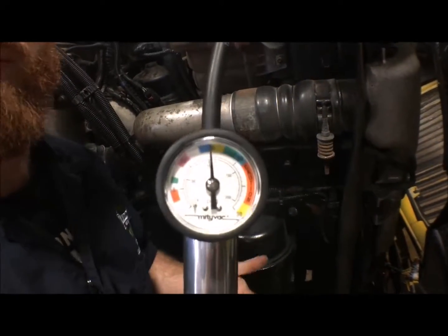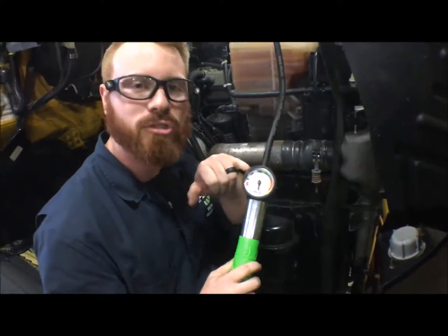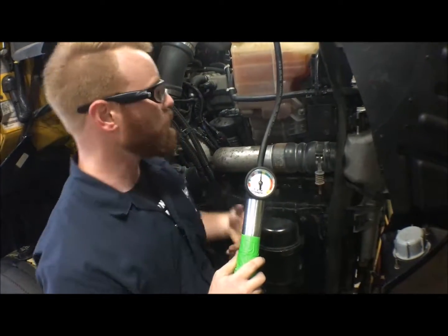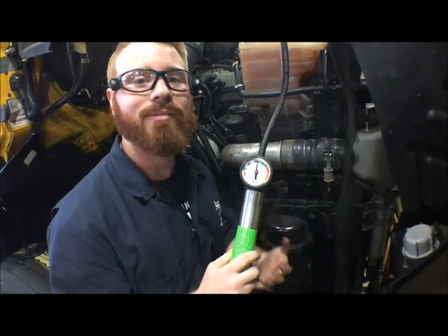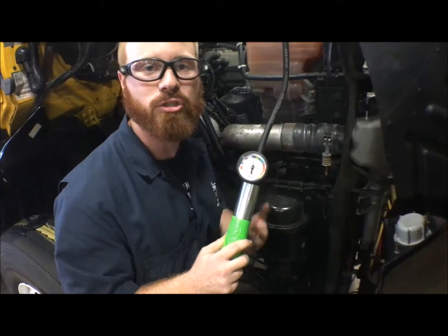What we're going to do here is wait three minutes and see if we experience any pressure drop in the system. If we do, if we see coolant rise, we obviously have a leak or a crack somewhere in our closed system that's letting pressure or coolant out.